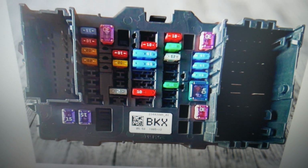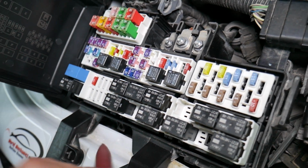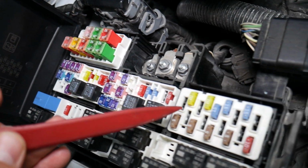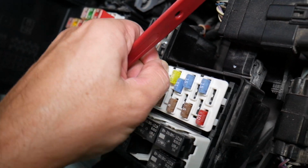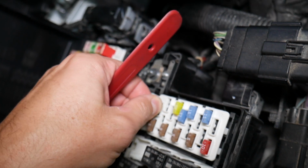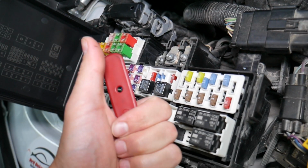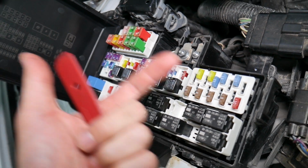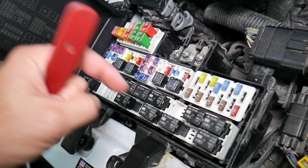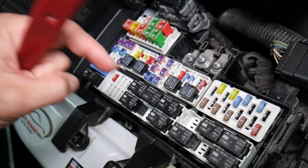Before we continue, let's explain quickly why it's always a good idea to test fuses and relays. It is very important to test fuses and relays. On those fuses you cannot clearly see if they're burnt or not. If you remove a fuse, look at it and assume that it's a good fuse, but it's actually a bad fuse, sometimes you cannot clearly see that. What can easily happen at that point is you put the bad fuse back in and start replacing parts and tools that you don't need to, so you lose your time and your money to fix a problem that doesn't exist, when all we had to do is test the fuse and replace it. We'll put a link to a special video that will teach you how to test fuses and check relays very easily as well. So check it out, it will be in the description of the video below.